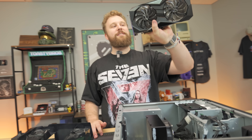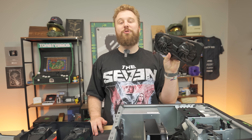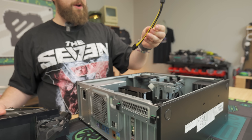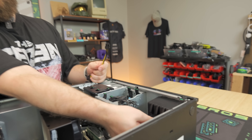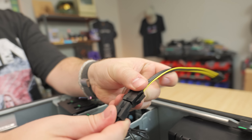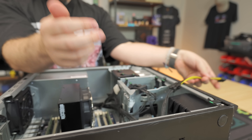Now for the graphics card — the RX 6600, which you can get really cheap now. We've deemed this the new RX 580, and in the coming years it's going to get even cheaper. It doesn't draw a lot of power either. This is our six-to-eight-pin adapter. These workstations have nice little slots to keep the power connectors. We take our six-pin power, line it up with the clip, and connect it — now we have an eight-pin. Easy peasy.